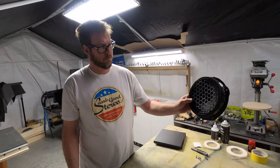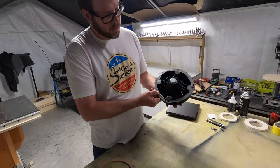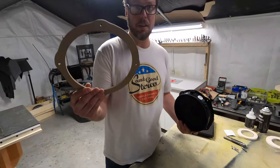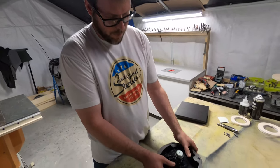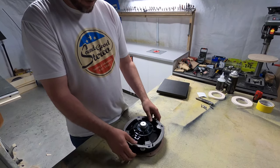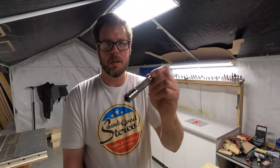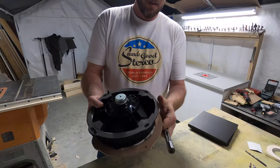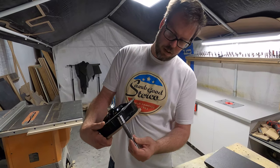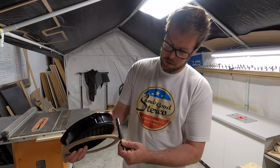Yeah, exactly. So we have the factory speaker. The first step in creating an adapter is to get this outside shape and our mounting holes, right? So what we do is take quarter inch. I already did this off camera. I'm not showing you guys exactly how this is done. You can't have all the tricks. But basically I put tape on the factory speaker, then I use CA glue and glue it down to quarter inch MDF. Then I have this super amazing four bearing super router bit from Mobile Solutions. Basically this goes down in the router table. It's so tall with a lot of bearings and I'm having a hard time holding this. You can set this so the bearing rides on the factory speaker and then it cuts our base plate MDF out as it's spinning, which is super dope.